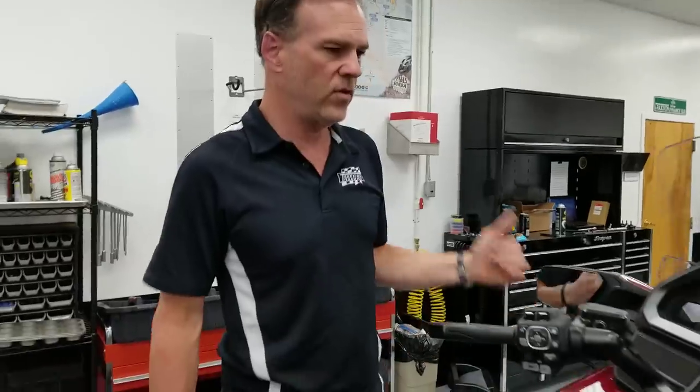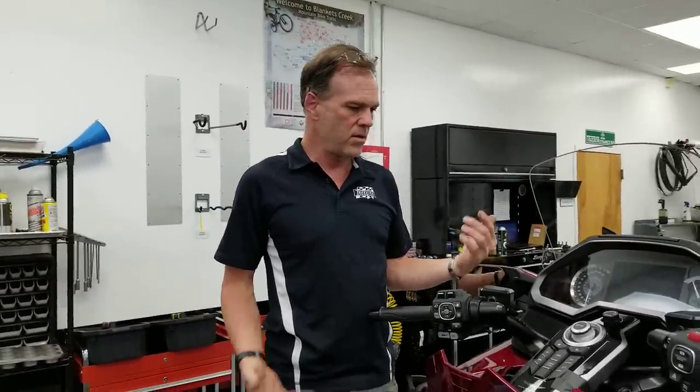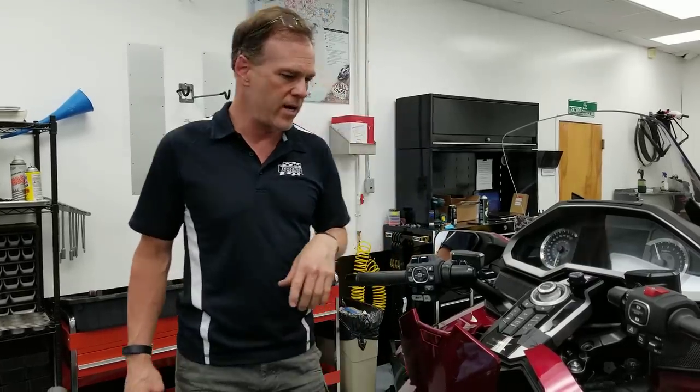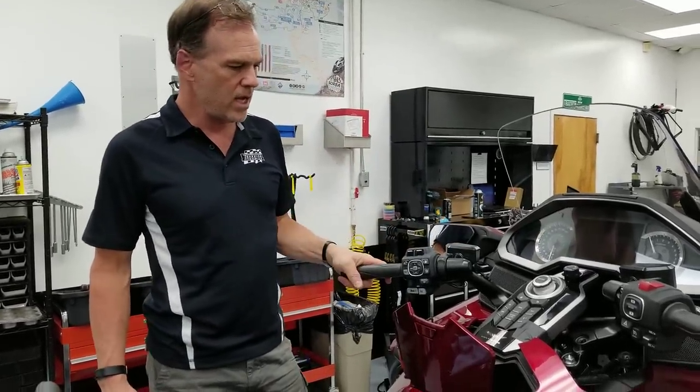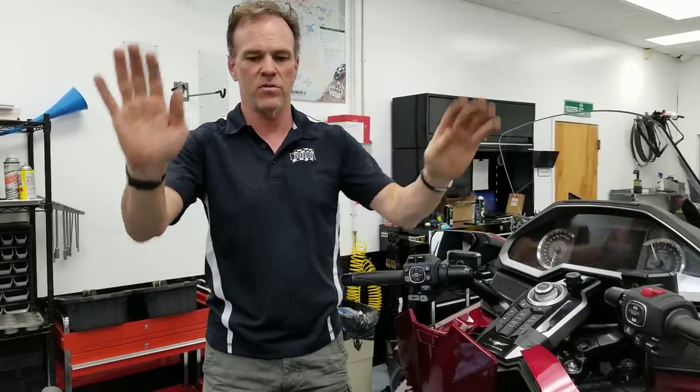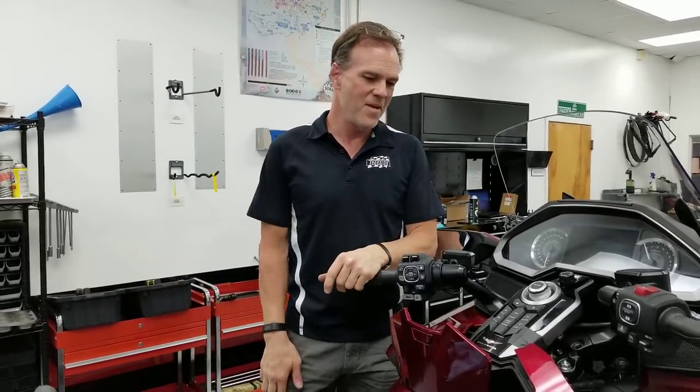So that's kind of the whole total steering system upgrade. That's the new Traxrite — one piece, fixed length, aerospace quality tie rod installed on the bike. Steering crown nut locked so it'll never back off on you 10,000 miles down the road. A solid mount bushing installed so that in the unlikely event the right tie rod ever fails, you'll be able to drive your bike normally. And your steering and handlebars aligned perfectly perpendicular to your front wheel so that as you go down the road, everything looks straight, square, and normal.